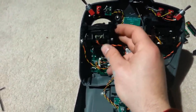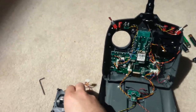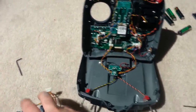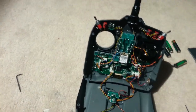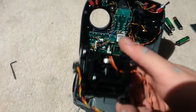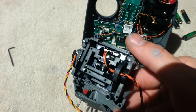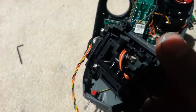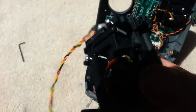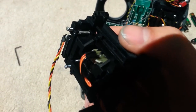These will have a zip tie on them. Carefully remove that zip tie so you can remove the wires completely off of the circuit board — be careful not to cut the wires. With the four screws removed, this will just pop right out. Once you've carefully removed the clip off of the circuit board, I used a very small flat head screwdriver to do that, which made it very easy.